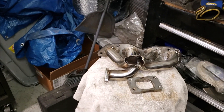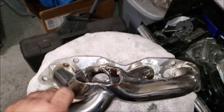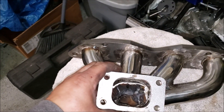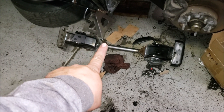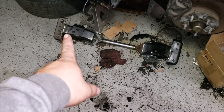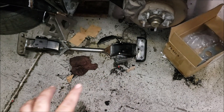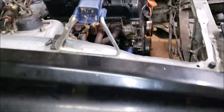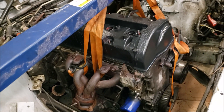All right, we got the T3 flange cut off. Now we're going to make this a bit more flat, grind it nice and even, grind off the old weld, and then finish up the crossmember. All I gotta do is add the top piece, put a little weld on each side for reinforcing, and add some gussets from here to here to reinforce this top section. Once that's done, we'll drill the holes, bolt in the engine mounts, and reinstall so we can remove the engine bridge and get the header and turbo mocked up.